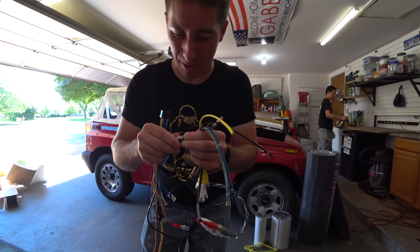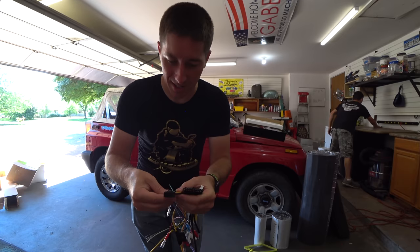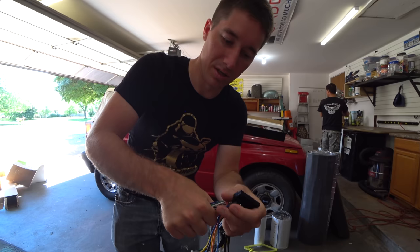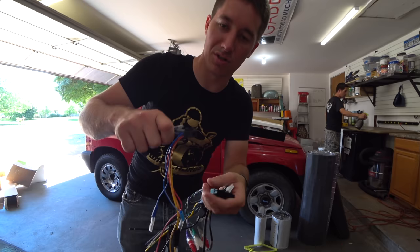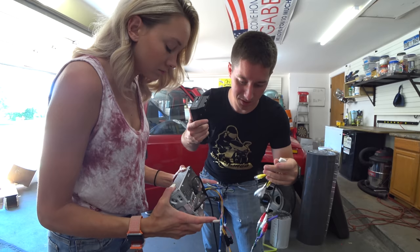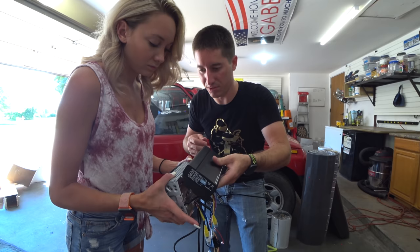And yeah, we are on track. I'm ready to start plugging things in and doing some wiring. Also, we get to tie off all of the speaker wires coming out of the head unit, which makes life really simple once you remove that many wires from the bundle here. So I will go like that, zip tie them, and then tape them off, and we will never speak of those again. Then we will plug in the power connector here, and we will plug in the preamp output here. And the only other thing that's gonna be fun to hook up is the mic input, but we're gonna have to find a way to do that with it all together because that goes on basically last.